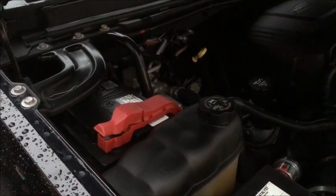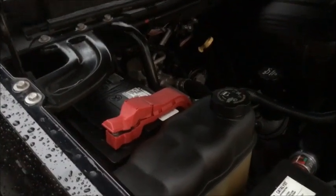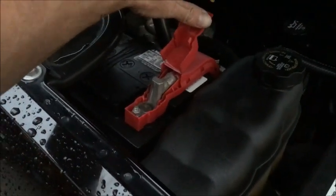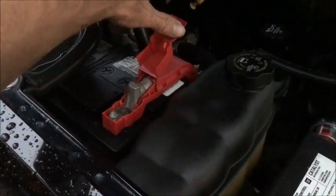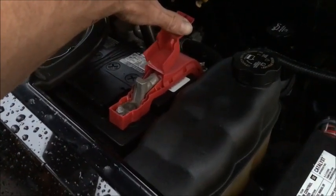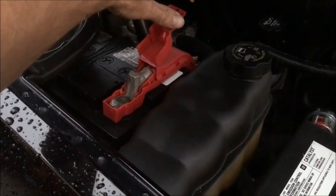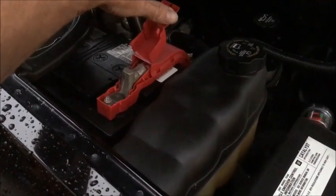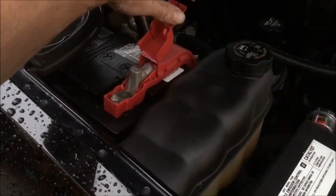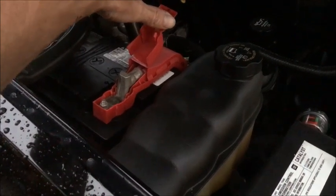The last thing on our list, now that we got our pump and suspension put on, is we need to disconnect the battery for a few minutes to get it to reset. That way it'll re-trigger the pump - in the back it cuts on right now but doesn't stay on, just a couple seconds. I think I have to reset it by taking the battery loose and letting it learn its home again. We'll get that done and hopefully we'll have everything done. Thanks for watching.